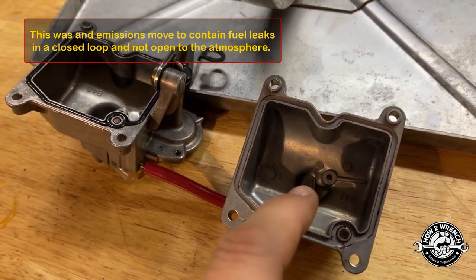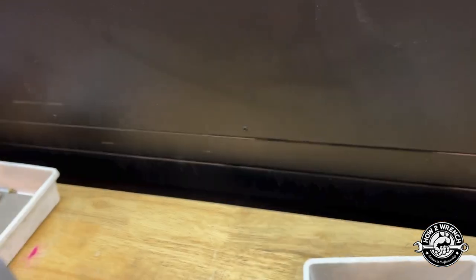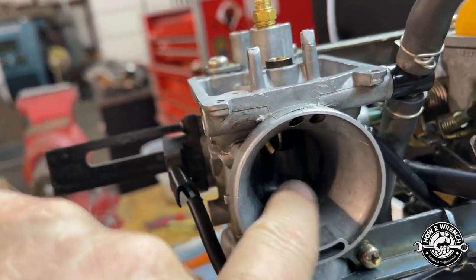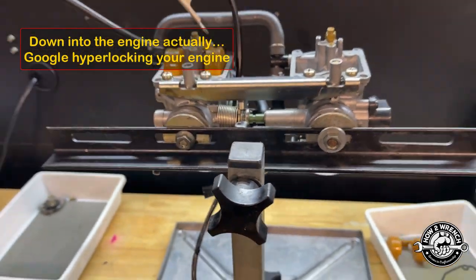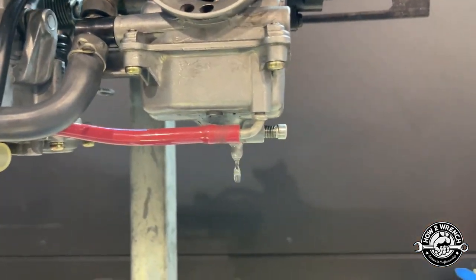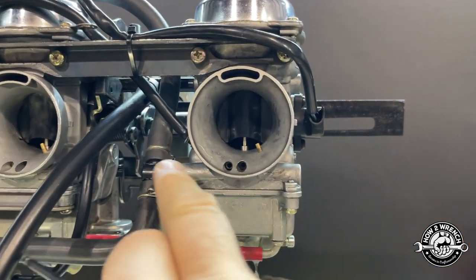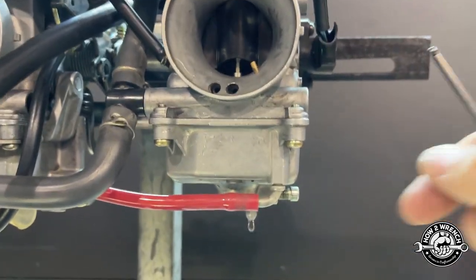When the fuel has nowhere to go, it's surely going to end up going out the emulsion tube and down into the carburetor, or it may fill up the air box — either of those are a bad day, one significantly worse than the other. When we open this drain hole in the cutaway it's going to drain. Let's find out if we have a fuel delivery issue or a needle-and-seat problem, or whether it's just the overflow tube.